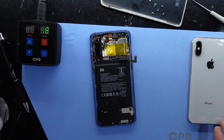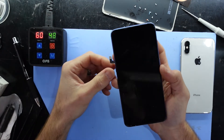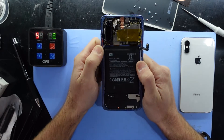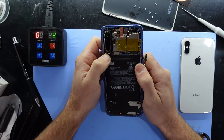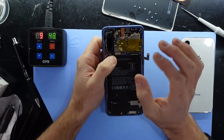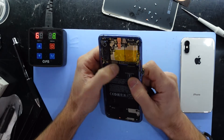Typically you'd be able to wipe it from there and everything would be all good — not so much these days. Right now you need an EDL authorized account to be able to do it. Previously you'd just be able to do the flash with no drama at all, which I'd done on other Xiaomi models, probably predating the Mi 8 or Mi 8 SE. The Mi 5, Mi 4s and so on — you used to be able to do the EDL test and wipe your phone from there. Now you cannot.